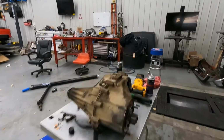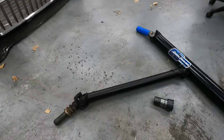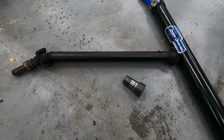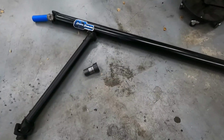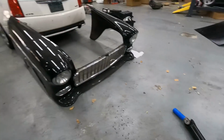The pieces that will be used: the front drive shaft from a 2500 truck with a 6.0 4L80 will fit in this. I had a rear drive shaft made by Dynamic Drivelines, and of course the Mark Williams input adapter will all be used in here too.